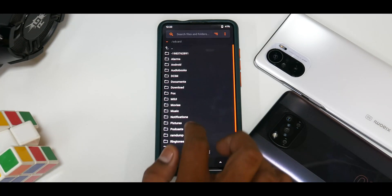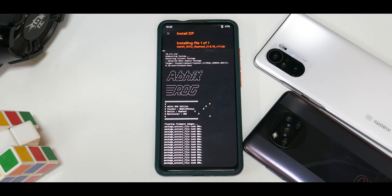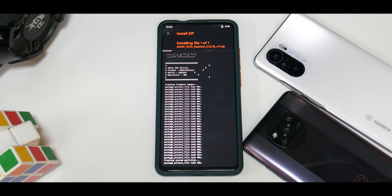We've wiped everything. Now let's select the ROM zip and swipe to confirm flash. While this is flashing, you'll understand the importance of a guide like this. This ROM is based on MIUI and the size is around three gigabytes, so it will take its own sweet time to flash — please be very patient. You also need to ensure you don't run into any errors. The reason I said more than 50% battery is that this is one of the longest first-boot ROMs I've seen — it took me maybe three to five minutes to boot for the first time. So if it's taking five or six minutes, don't panic — just leave the phone alone, go play on your PC or have a cup of coffee, and come back to find it on the setup screen.